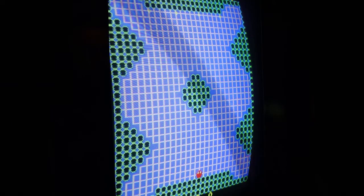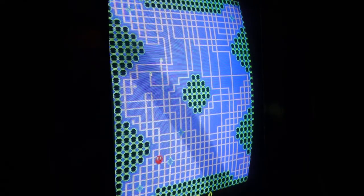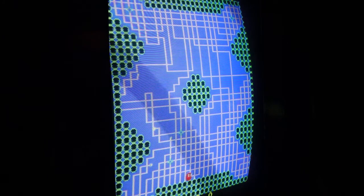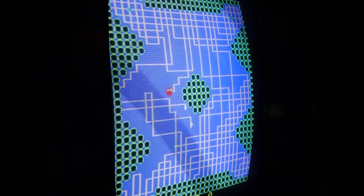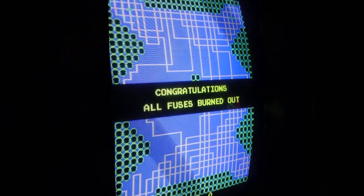Try to adjust the exposure a little bit on it, because this game's a little bit brighter than some of the other games. Some of the other games are a little bit darker. And those rolling lines that you can see, that has to do with the frequency refresh of the monitor and the camera. So you'll see a line scrolling. That's how you can always tell it's a real CRT, right? Because you'll see those lines scrolling depending on the frame rate and whatnot. But in person, it looks great. There's no black lines. And actually, these games look great on these old monitors. They don't look so great on the new LCD stuff or the LED. They look real pixelated, just the way the interlacing works.